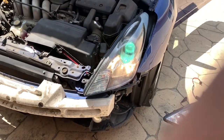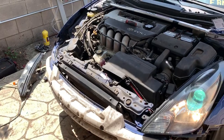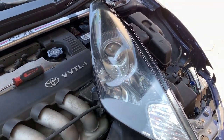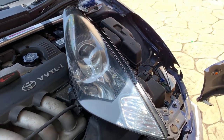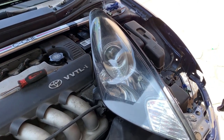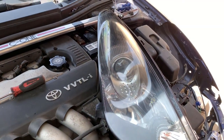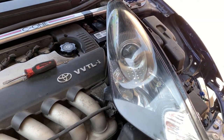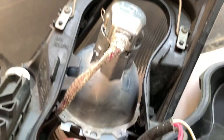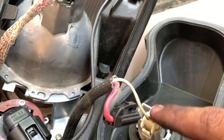There it is - turns on high beams and low beams. I rewired the left-hand side but it doesn't seem to turn on the low beam. I tried it on the other side and it's not the wiring, so it has to be the ballast or the light bulb. I'm going to swap it out and see if it works. This is always why you check stuff before you install everything. I think I found my problem - I opened it up and this connector wasn't even plugged in.